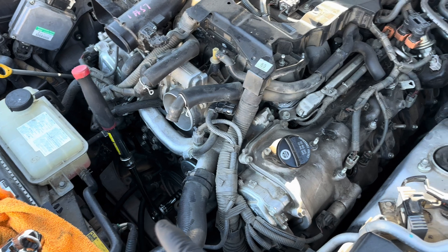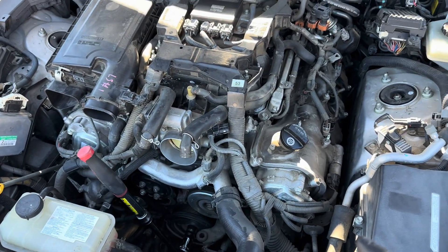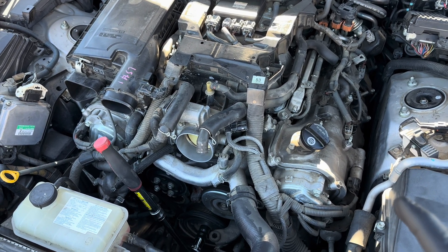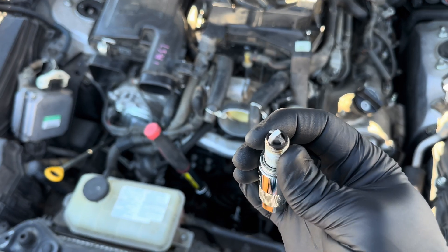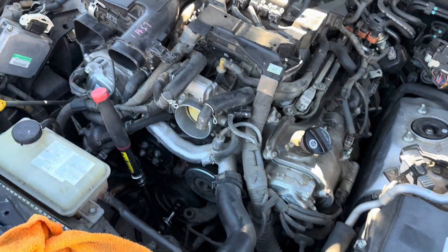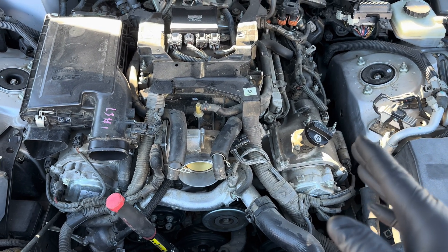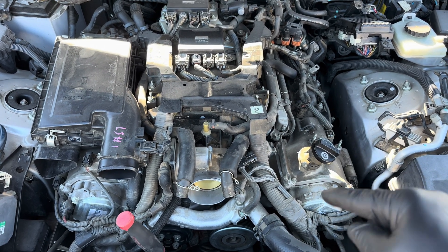I rotated the engine a couple of times and couldn't really see the inside the intake valves. The stems look pretty clean, so our problem isn't necessarily with the intake — the ports are actually keeping the inside of the valves pretty clean. But you can see a ton of carbon buildup, and here's the telltale sign of an oil consumption issue: the ashiness on the spark plug. That white ash buildup is usually caused by burning oil, and you can see the excess carbon in there.